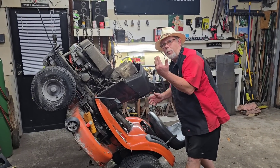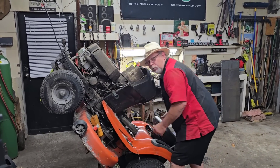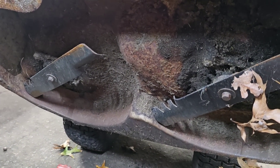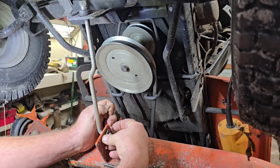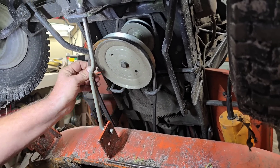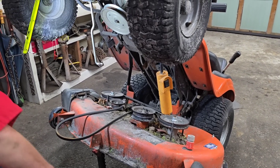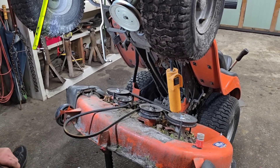I've got it up in the air so you can see what I'm doing. Next, set the parking brake just like that to loosen your drive belt, then lower your deck down. This thing has been sitting for months in the yard — we were busy all summer. Let's get this deck down and out of the way. Get this little clip out of the way, take the belt off, get the deck down. If you're doing this at home on the ground, take that deck off and get it out of your way — it'll be a lot easier.